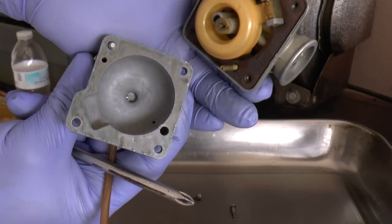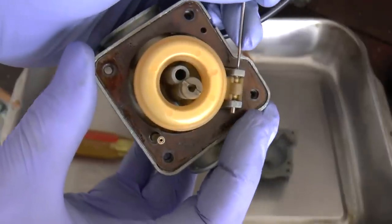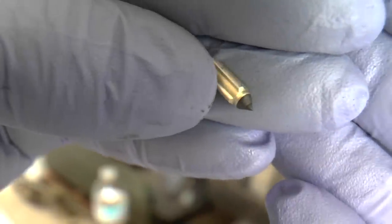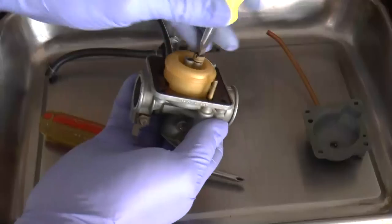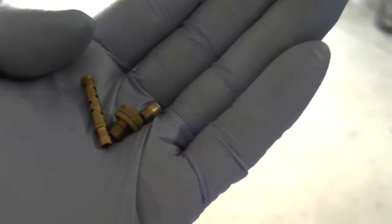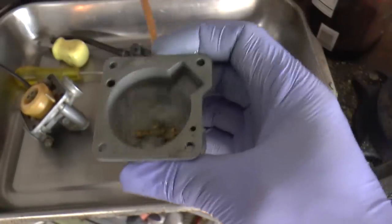Wow, not too shabby. Very clean float bowl — very rare, especially for a machine whose previous owner said hadn't been run in some time. I'll just push out this pin. And here is the needle valve. It looks a little bit worn, but I'll clean everything out and see if it'll seal. I got the float valve put back together — I think it's good. Worth a try anyway. It may not be necessary, but since I'm in here already, I'll remove and clean the main jet and pilot jet. Overall they look really good. There was a little bit of gunk on this tube, but nothing so bad it wouldn't run. Both the main jet and the pilot jet are clear — you can see right through. I haven't even cleaned these yet, but just for good measure I'll give them a quick gas wash then button it all up.